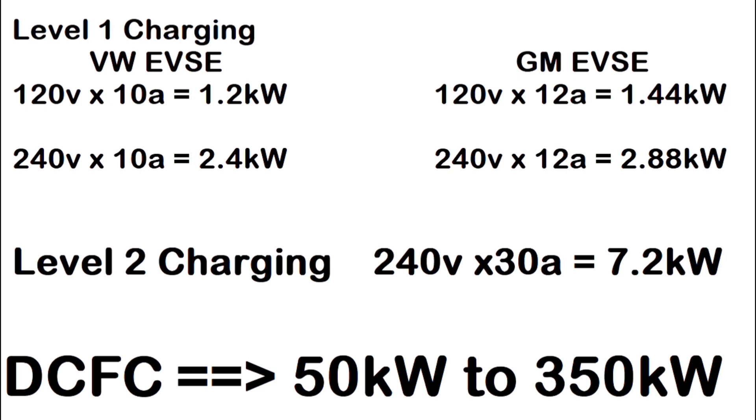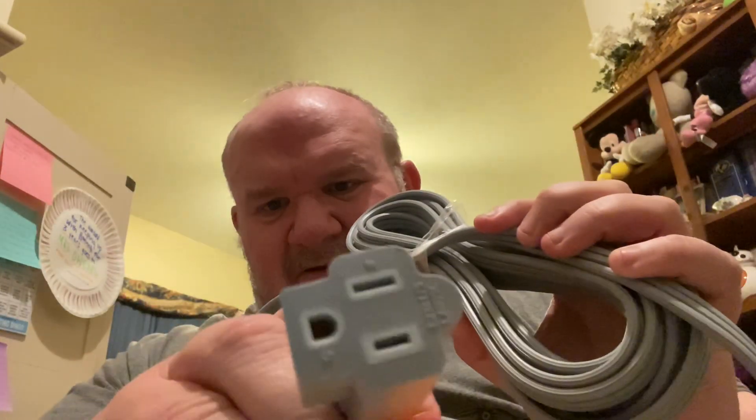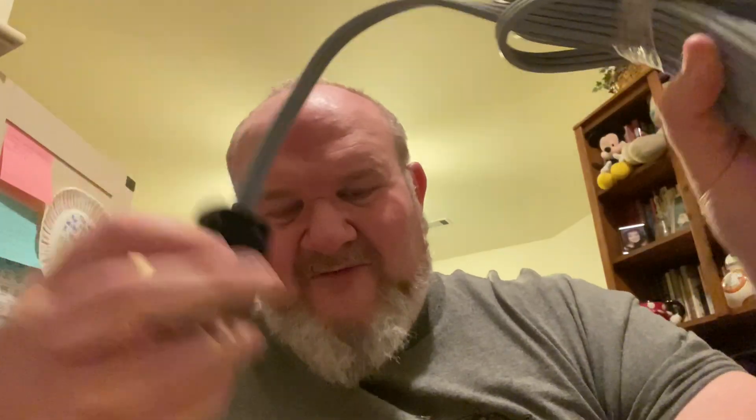Let's look at the examples and I'll show you how I do the 240-volt run-through. The way I build these particular cords: I use appliance extension cords — regular three-pronged extension cords — and hook them up to a 240-volt plug. The internals on these EVSEs don't make a separate European version; VW and GM just use the same internals and lop off the end, putting on either a 110 or 220 plug depending on the market.